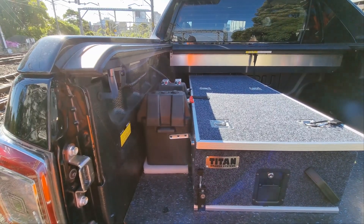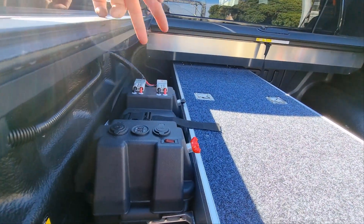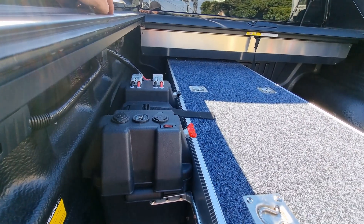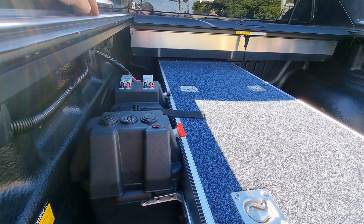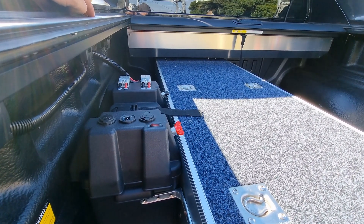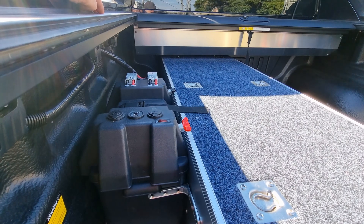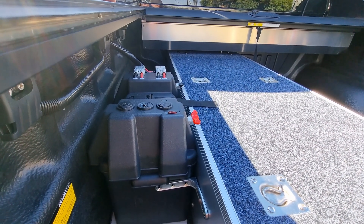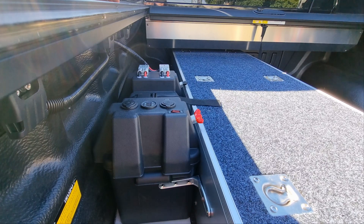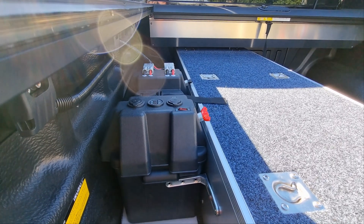For wiring, I've got two plugs — one to the control box and one from the power in from the DC-DC charger. From the battery box I have the negative mounted to the body, so it runs off the body negative through the chassis, meaning I didn't need to run an extra wire for the negative back to the main battery. The downside is that if the battery box is disconnected from the DC-DC charger there's no negative feed, so I had to add an extra negative feed in from the control box.